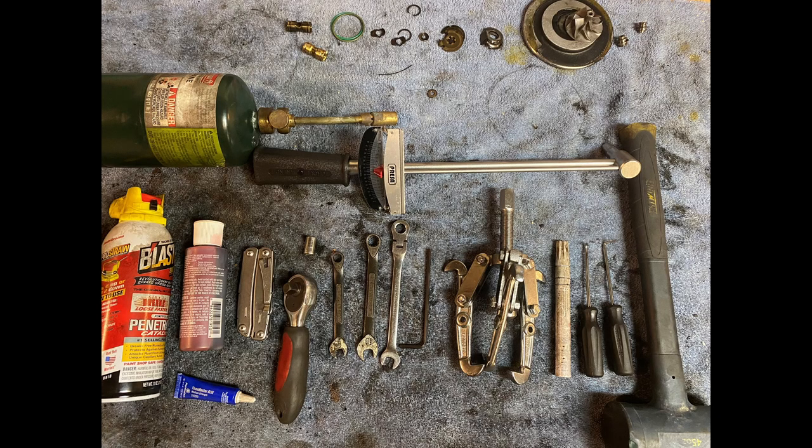Here's a quick list of all the things you're going to need for this rebuild, aside from obviously a rebuild kit. The turbo gets pretty stuck — it goes under some pretty brutal thermal cycles — so you're definitely going to want a mallet, some PB Blaster, and a torch of some kind. Almost everything is a 10mm, and you'll want something low profile and ratcheting. To get the turbine and compressor off, you'll need an 8mm and a 3mm Allen key. You'll also want a puller for the compressor side, a paint marker, some picks for the snap rings, Loctite, and assembly lube.